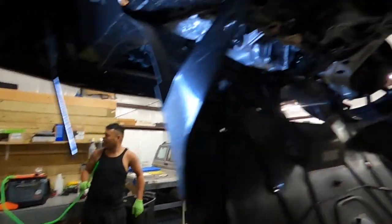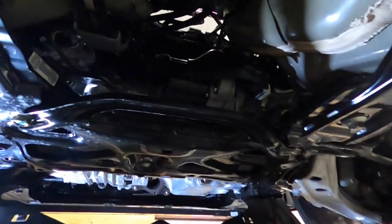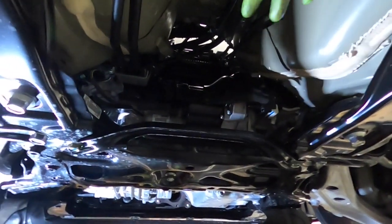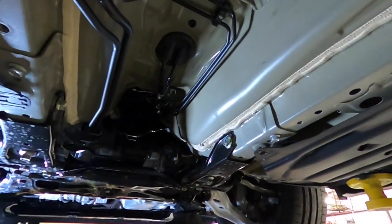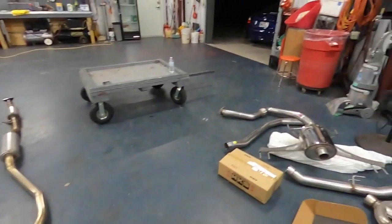Alright, so Vic here removed the aluminum we got there. That is the biggest issue trying to get the up pipe off because it's always hitting, scraping, bending. And I seen a video of a dude on YouTube that I follow, and he was hearing a little noise because it bent. So I'm assuming the installer didn't remove this. I don't blame him, but it's just a quick, you know, 1 minute to remove and it's worth it. So it's all there. So now you got the up pipe off and the full exhaust off.